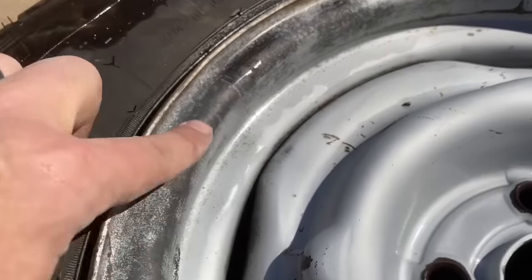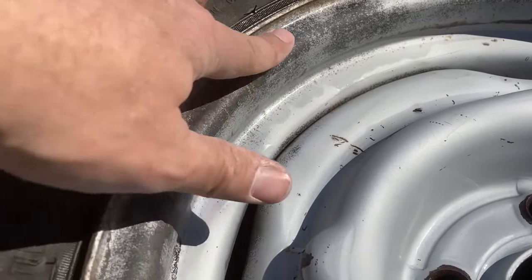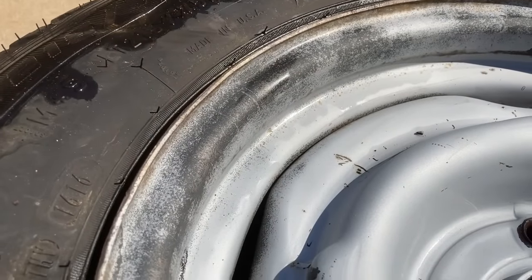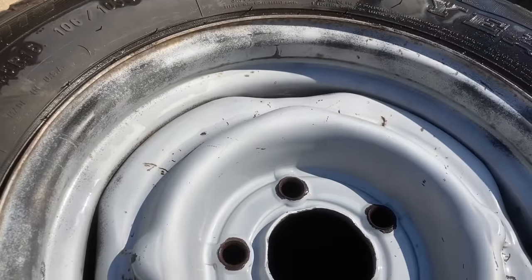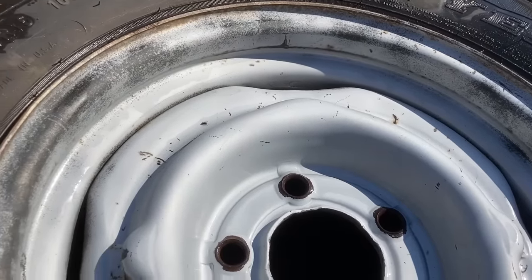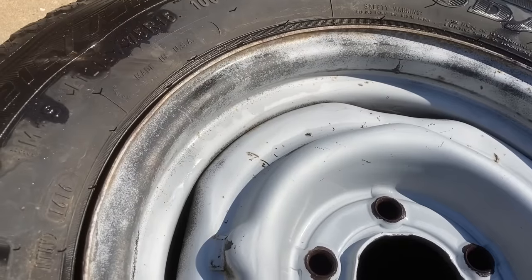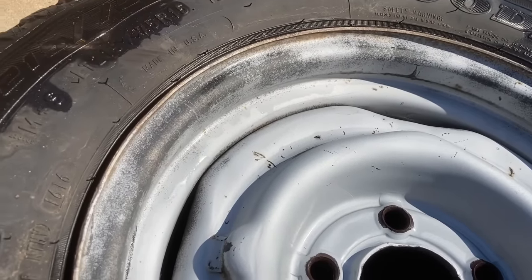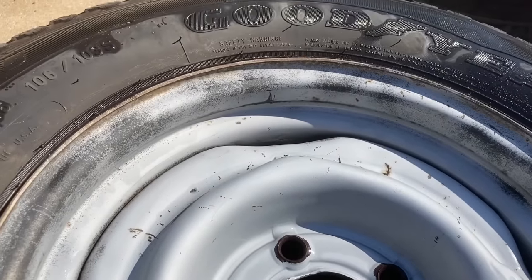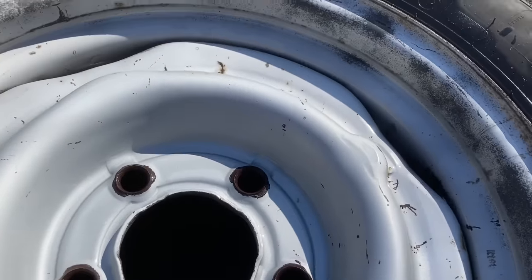And just a recap, if you do put the pressure on it and use enough material, it will take the paint off. Of course, this is very thin paint. It just goes through too much material. I know that at Harbor Freight, they sell the baking soda that's made for soda blasting. I've read that that's what you're supposed to use and that regular baking soda won't work. That's not correct. As you can see, regular baking soda does work. Maybe the one designed for soda blasting works better. I don't know, probably, but I've never tried it.